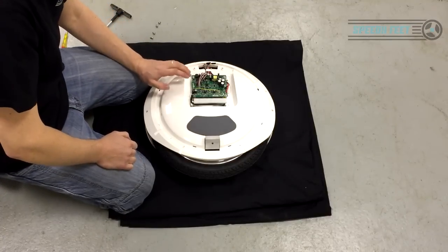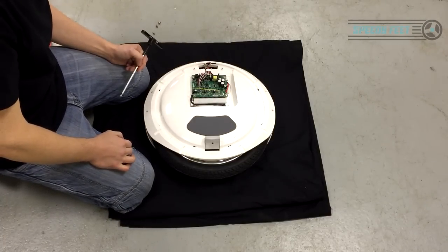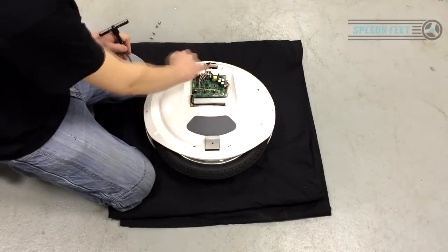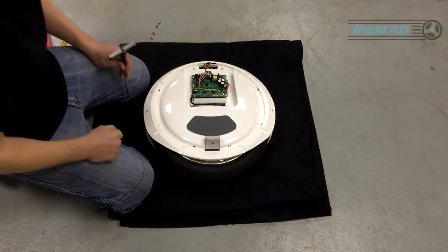Another thing that's come up is the tightening of the screws. The screws here are torqued up to a specific level. Don't go along and tighten them all up, because you run the risk of fracturing or ruining the threads where they go in by over tightening them.